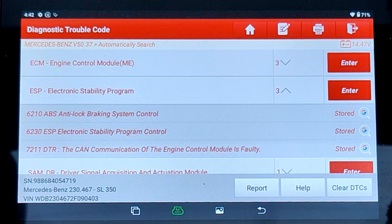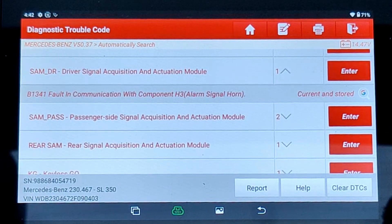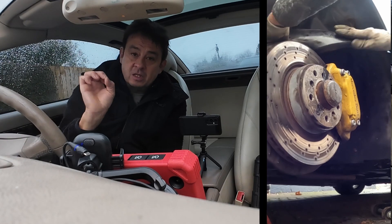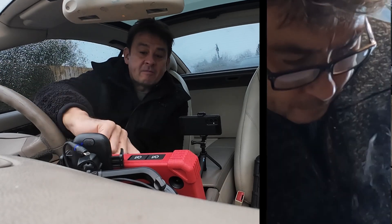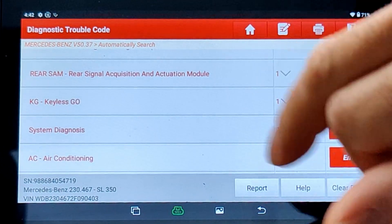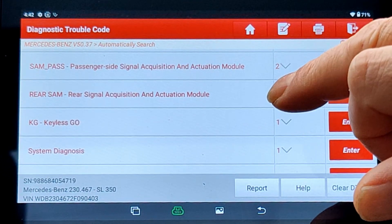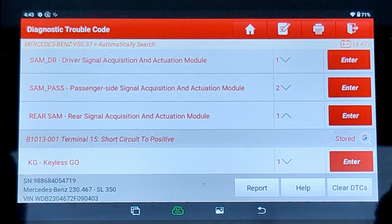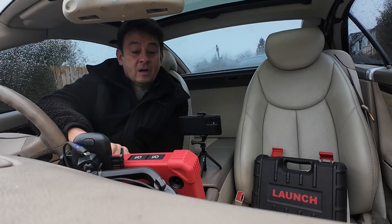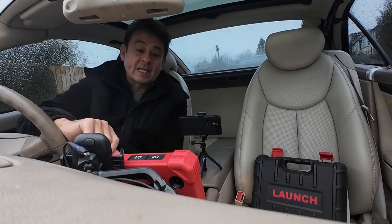ABS anti-locking braking systems and electronic stability - looks like there's a fault there. Again, I believe it's down to low voltage. The SAM - that's saying I've got a fault in communication with the component, the horn. I know what that is because the internal batteries have run out. It's 21 years old and inside the siren I've got to replace it. Let's go importantly to the one we've got on the dash, which is not going to be air conditioning, although it says I've got two faults there. I know what the fault is - I've got a dodgy door sensor. It could be the rear SAM - short circuit of positive, that's probably moisture somewhere. She's an old car, she needs a little bit of TLC, but that's why it's so good having these diagnostic tools. This Launch, by the way, is an excellent example of that.